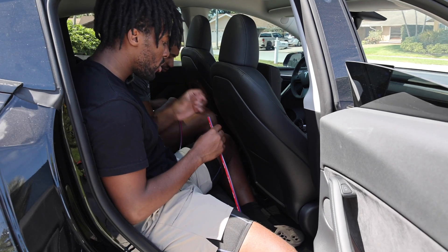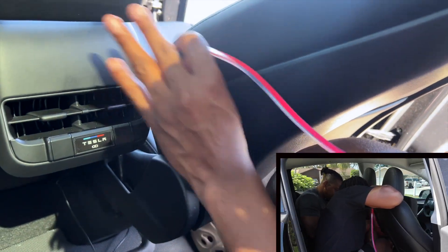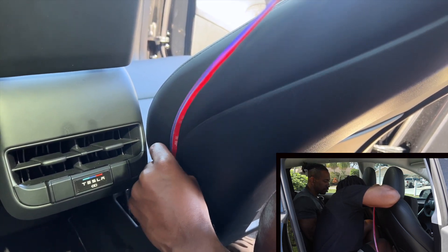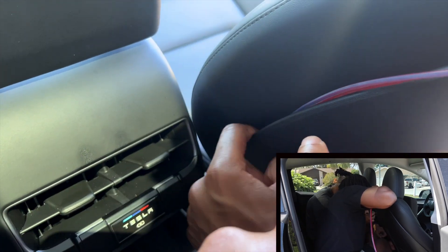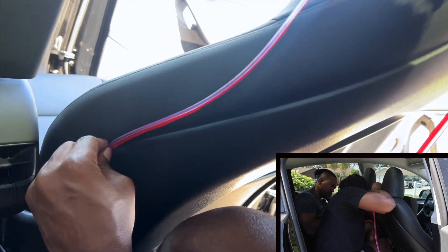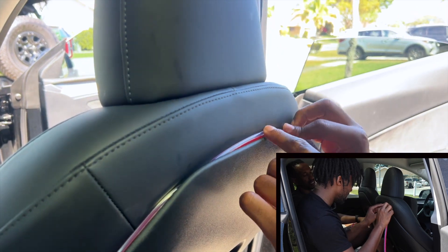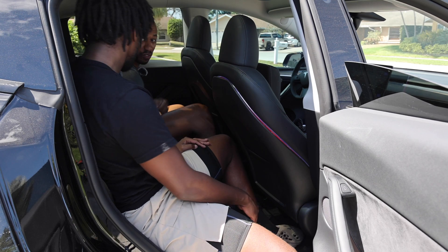Next is the backseat. When you're lining up, make sure it's close to the edge because this is where you're gonna be feeding all your wires into the center console. Leave about an inch — do not put the 3M all the way to the end. Line it up first so you can see where it needs to go because it can go deeper than intended. Then take out the 3M tape as you go and you'll get a gist of what to do. Be delicate — it'll stick with the 3M so you won't just be able to shove it down.